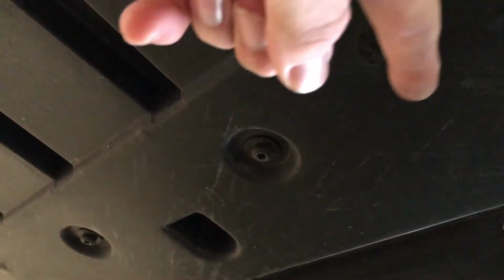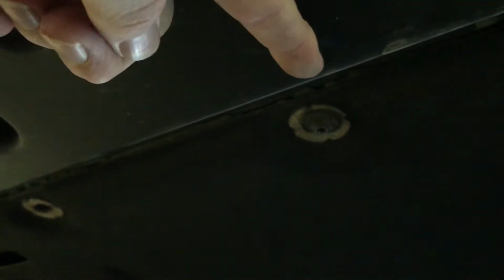Now I'm up under the car here, so it looks like we have a little bolt here, and we have several across the front of it. We also have some, looks like these are T25s, right here as well. We also have some back here, look like the same thing. We have a total of 3 across this part back here. And here's the splash shield. We have something over here. I think these are some sort of little retaining clips that'll just pop out. And then, like I said, we'll get all this taken apart, and then we'll jump up in the fender well.